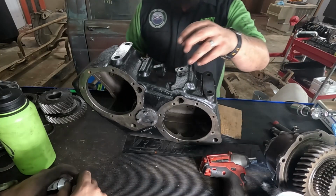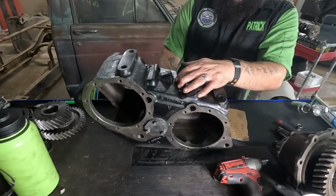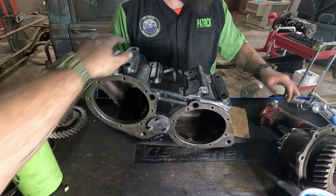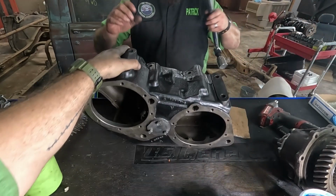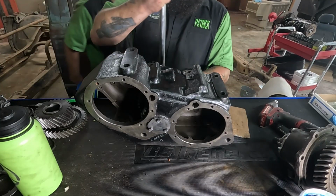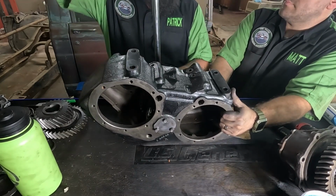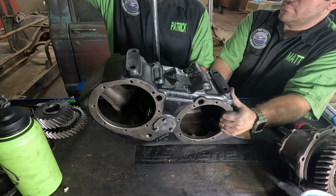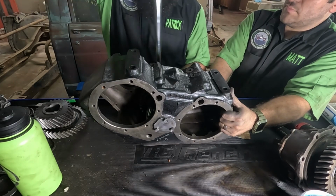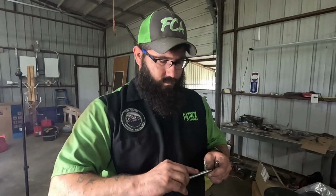All right, washer. All right, so the washer, bolt naturally. All right, now for the fun part. Matt's gonna hold it, and I'm gonna torque. I'll scoot it closer to you. But we're gonna torque this bad mamma jamma. It's a 1 5/16", I think, or what we're using is a 3/4 inch drive 34 millimeter. And it's torqued to 120.